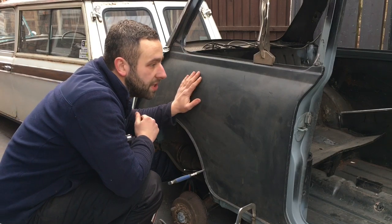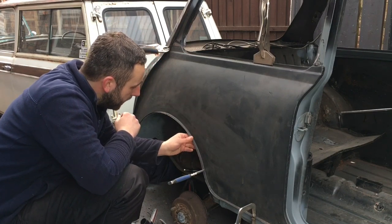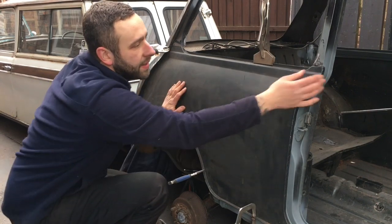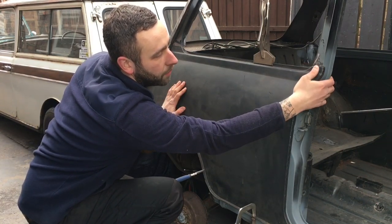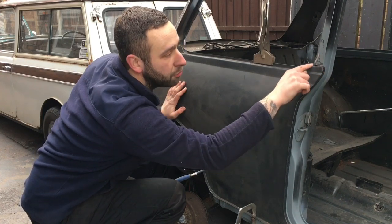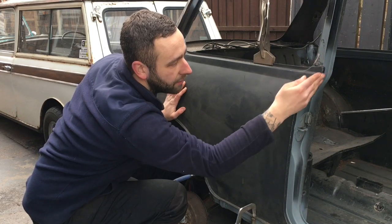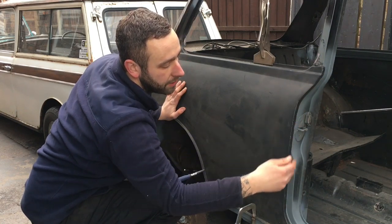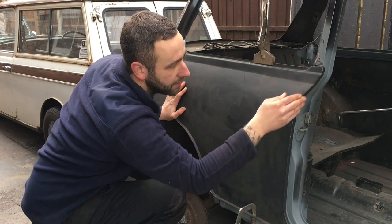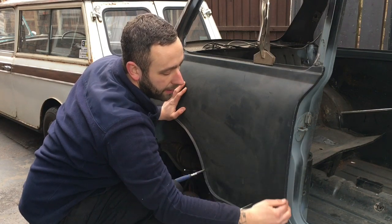So I've got the quarter pretty much where it's going to need to be - needs pulling tight in a few places, got a nice gap there, a little bit too big in one spot but that's where a bit more rot was so I've cut out, and you can always bridge that so I'm not bothered by that. I've heard that these pattern panels need tapping back and you can feel there's a gap there, so this edge will have to be plug welded regardless - I'll just plug weld, tap, plug weld and tap it all the way down.